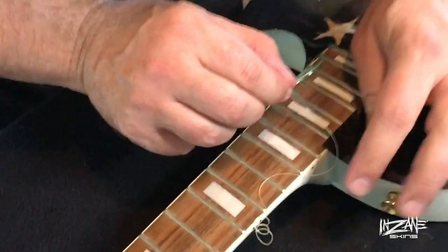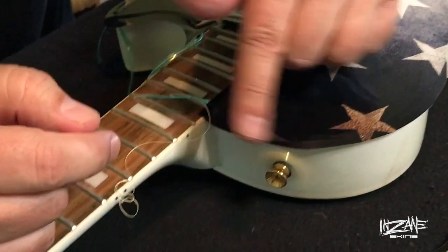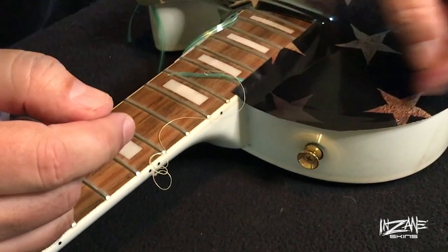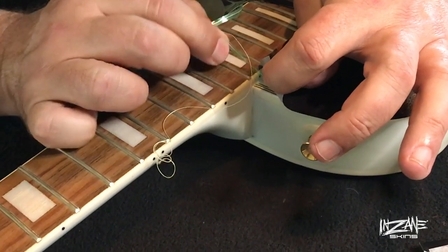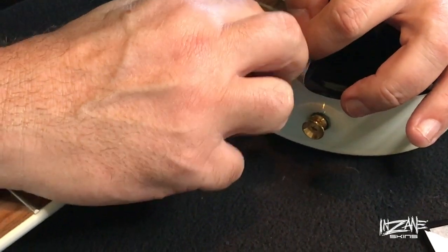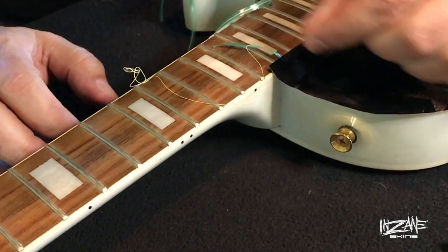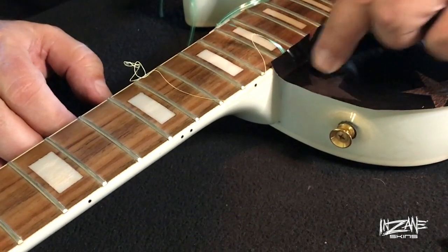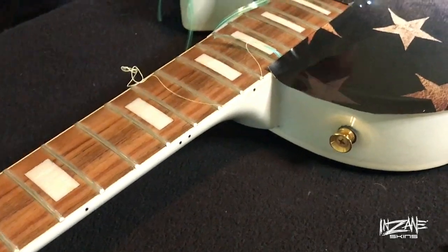One thing that I have learned by using this Knifeless tape, and it's probably because it's on a guitar body and we're talking about beveled edges and starting from a neck where we're coming down, is I like to slice the skin prior to cutting with the Knifeless tape, because after doing all that effort, I have pulled the wire to try and get it through the skin and snapped the wire. So by cutting the skin a little bit, it gets me started. So let me do that.